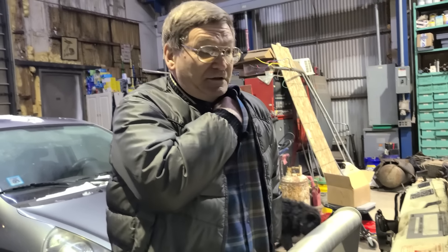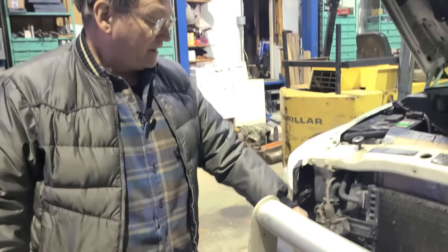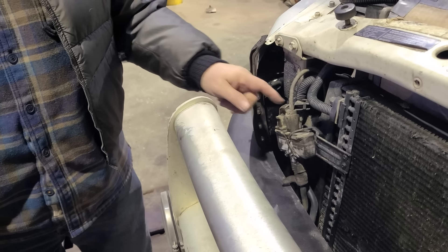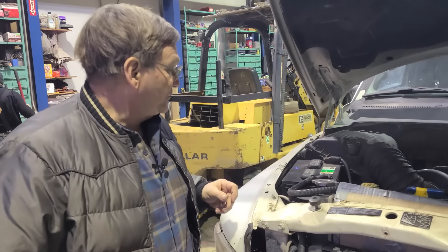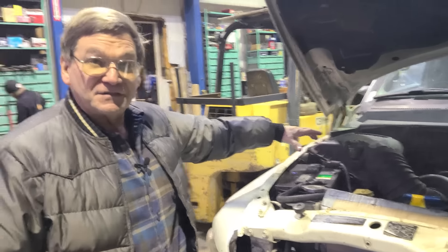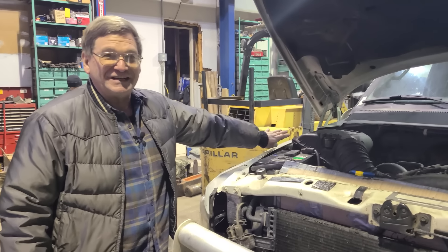In the fall it's good to go underneath and check the plug-ins. A lot of my vehicles were already winterized when I got them. This one has a cord block you can plug into. It also works if you cut the ends off the cords and connect them together — soldered heat-shrunk connections are real good. A common old setup was mounting a regular household electrical box on the fender, but the plug-ins aren't rated for road vibration; the plug falls apart, shorts out — it's a nightmare for no reason. It's better to just wire them.